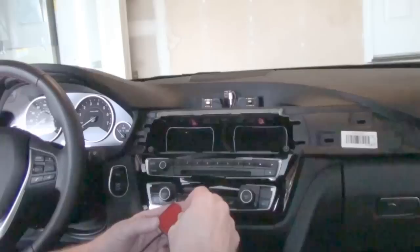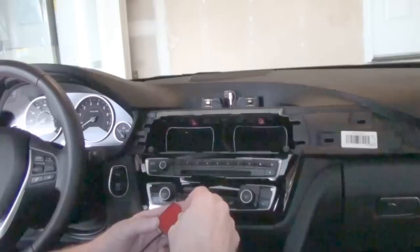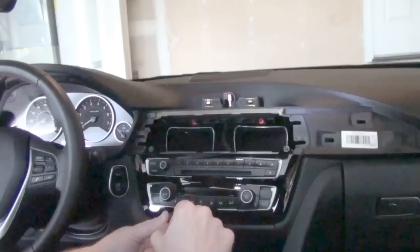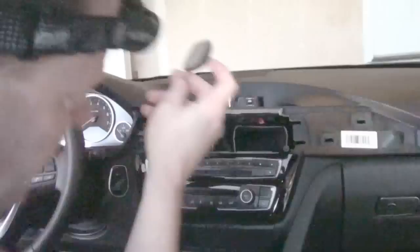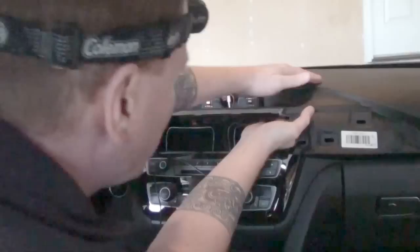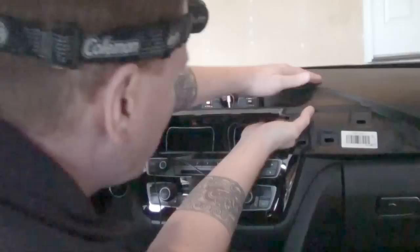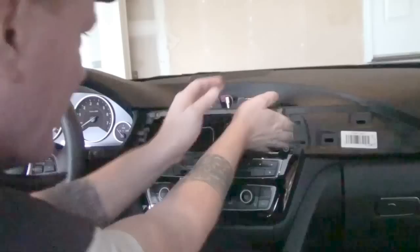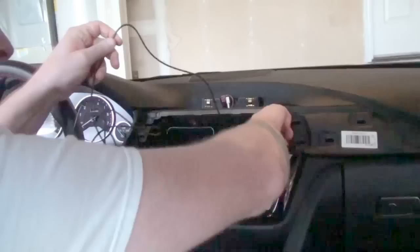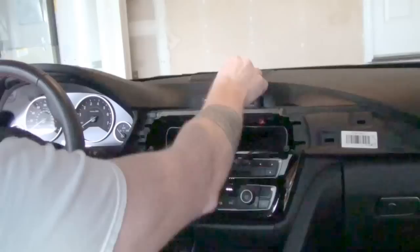Now's a good time to make sure the rest of your dash is clean. We'll route the GPS unit around the dash and coil the extra cables down into this empty space. I've applied the GPS antenna up nice and high inside the dash where it should have good visibility. Also keep in mind that when dealing with the optical cable, I pulled it out in front of the vents to get more space to turn the display around — make sure when you put everything back together that cable is back in the right place.